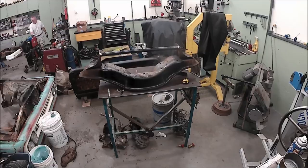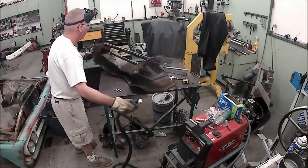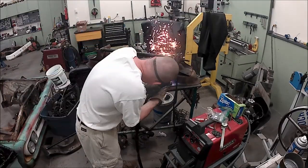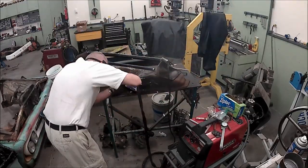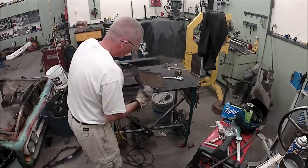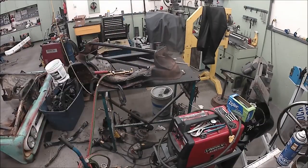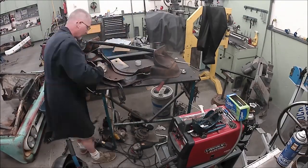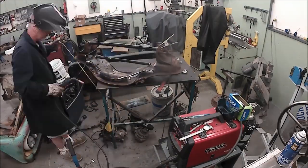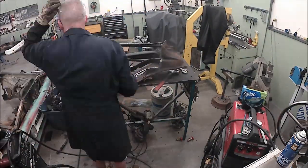So I'm doing a bunch of changes to the frame to make sure I can ride low. One is pancaking the crossmember — we take this crossmember, cut two inches out of it, and weld it all back together. We plasma cut the whole top off, and that stays in the same location with respect to the frame, but the rest of it is shortened two inches. So the upper control arms go up two inches, the lower control arms go up two inches. The original crossmember actually hangs two inches below the frame rails, so by doing this modification, the crossmember does not hang two inches below. The torsion bar adjuster crossmember hangs four and a half inches below the frame, which means if you ride low, that's going to catch on everything. Here I'm spraying a bit of zinc weld-through primer — figured if I'm putting her back together, might as well try to seal it up.